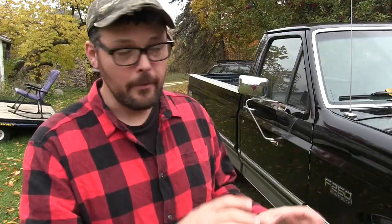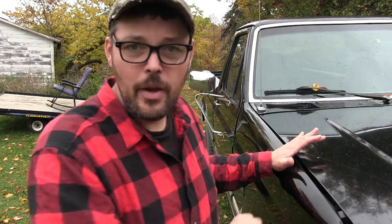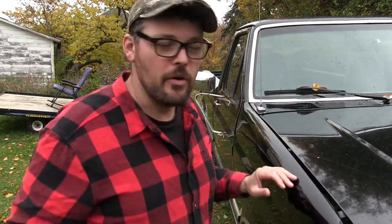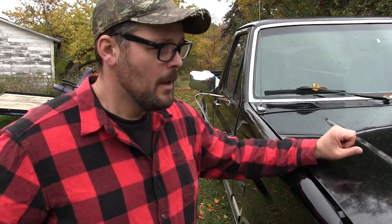So I've washed this truck using the best industry practices — what's it got me? What's the point? I think the real heart and soul of all of these things people say to do when washing your car is about damage control. When you're cleaning your car you're trying to do the best you can to keep it maintained. You don't want to take the dirt that's on the paint and scratch or damage the paint further. That's why you always work from the top down, so you're not washing dirt onto an area you've already washed. The microfiber mitt embeds the dirt as opposed to it sitting on a thin surface like a t-shirt or a rag. Keeping the paint wet helps the dirt and debris slide off. Working in the shade means you're not dealing with paint and clear coat that's heated up from the sun — it's at a stable condition. The only reason anybody washes their car is they want to take care of it and they want it to last a long time. All of these best practices lead up to one thing: it keeps you from damaging the paint while you're trying to preserve the car.